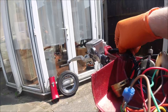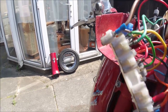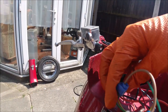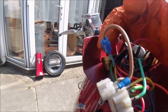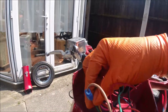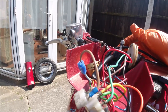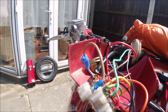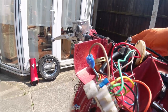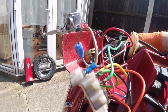I've pulled the cables from the switch in — they're connected red to red, blue to blue, orange to orange — because that's the AC from this switch. That's the AC coming up from the loom, so I needed to feed it back into the switch. Because this is an AC/DC switch you have to join the two cables so that it works the pilot light. What you're doing in effect is putting the AC side where the battery side would have been, so you've got power on both sides of the switch.